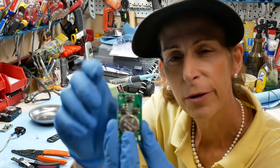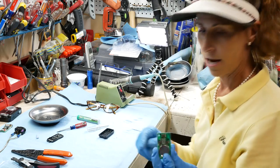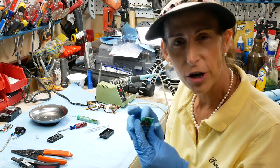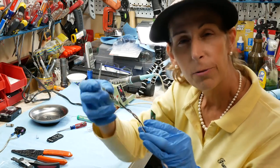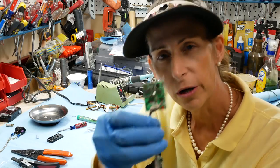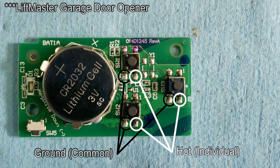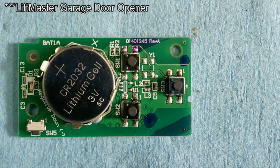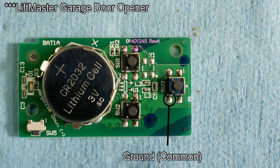I've put a little dot on the circuit board to mark the small door button so I don't forget. The next step is to trace the circuit board traces to find the common — that'll be our black wire in the wiring harness. Then we need the other side of the two switches for our two white wires. The ground is here, the hot is the other side, so we'll use the one on the far right and the one with our little blue dot.